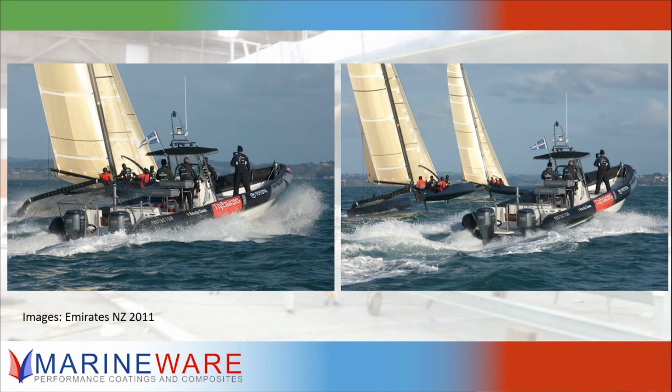So if you're putting down a base color of Durepox primer, you can then just go straight over with some high performance clear because it's all the same system. Yeah, I used to use it quite helpfully for flattening down. If you had a primer with the clear added, you would still end up with a more satin finish rather than the matte finish of the primer.